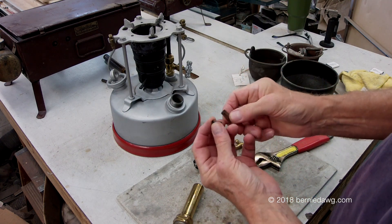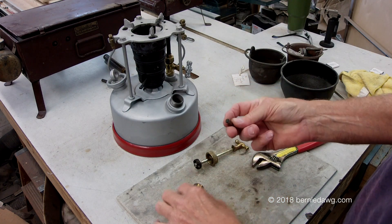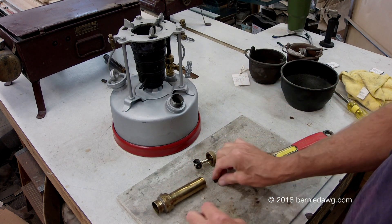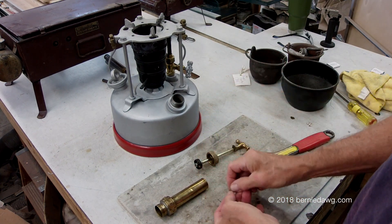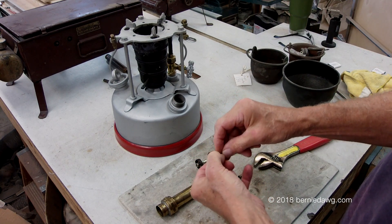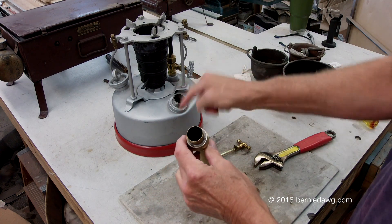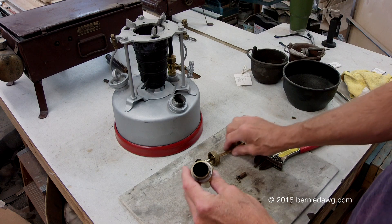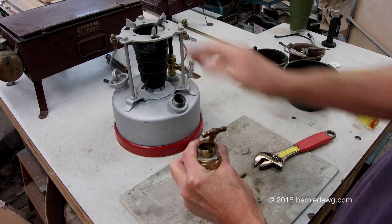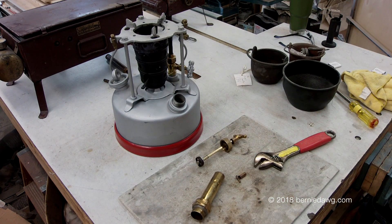This is the little NRV — the little spring goes on here like this, goes into the tube like this, and screws onto the end of the pump tube right there. The important thing is to make sure that this pip right here, this little rubber pip, is fresh and resilient. Mine has gotten dried out, so I'm going to make a new one. If it's not resilient and not sealing well, when you pump it up the Coleman fuel will back up into the tube past the pump cup and come squirting out — and if things are lit, you're going to have flame. Bad, bad, not good.